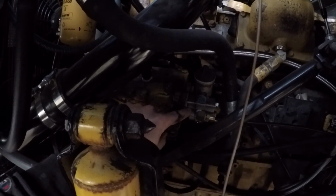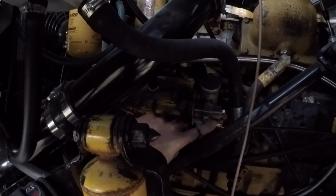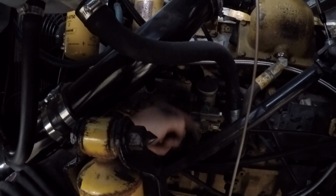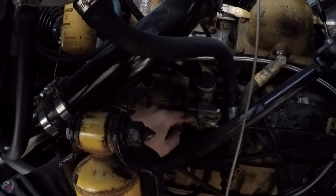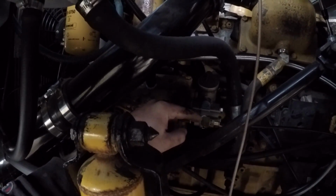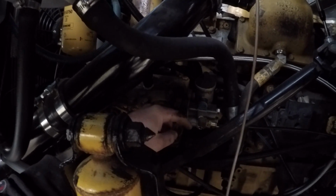But anyways, so I mounted it right onto the compressor, which you can do. These things are pretty universal. You can mount them upside down. There's a spot in the front of the compressor that you can mount them to. I think you can even mount them sideways, because I think there's another set of holes here. But with these bolts here, you can't get a fitting into the end there, because I wanted to come out of the side of the dryer with both of those, and you can't get a fitting down into there because the bolt heads are in the way, so you have to come out of the side of it. So that'll work, but not the way I wanted to do it.